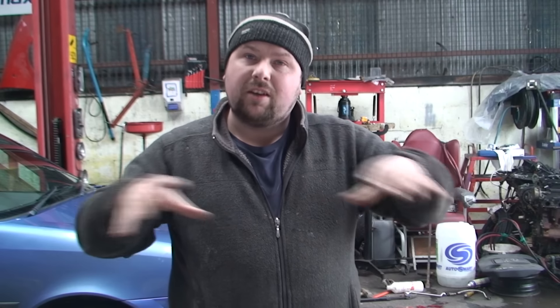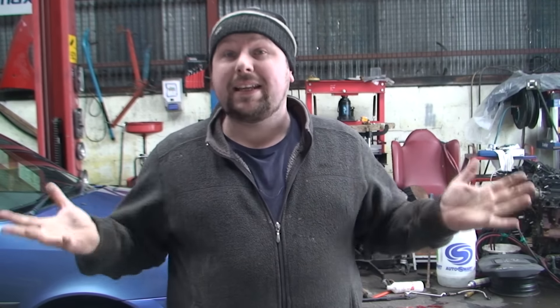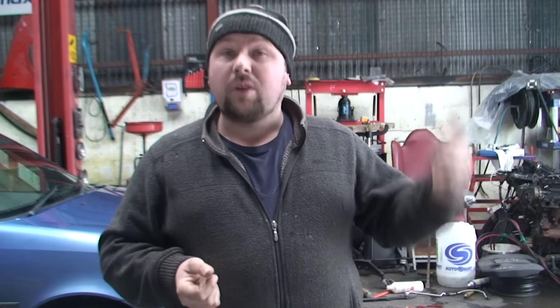In England or Ireland — that kind of weather — you're looking at 13.9 to 14.5, preferably over 14 volts with everything switched on. So that's basically it. I now know the alternator is faulty.